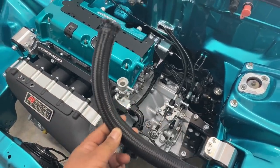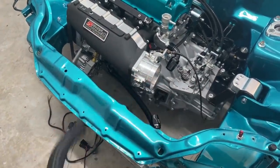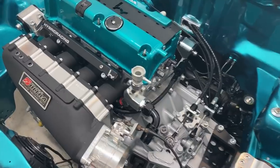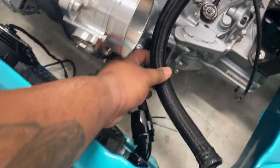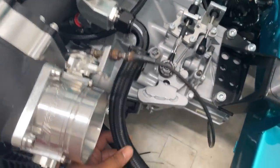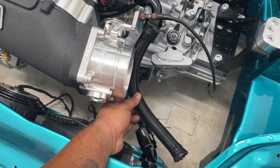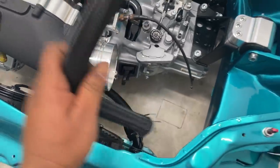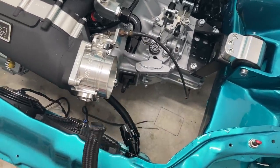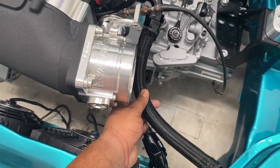We're going to do the top hose now. This is all the stuff off of my old H, even on my V-Series — I'm still using the same hoses. This is all from color fittings. Longevity — multiple swaps. It's already kind of bent. I have a 90 coming off of the upper housing to a 45. It should sit something like that. I wanted a 90 because I know the intake is like a three and a half inch and I want it to go under it — that's why I got a 90 here. I'm going to do the same things I did to the lower hose and I'll be back.